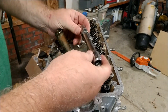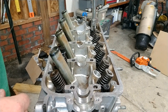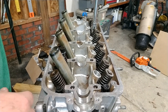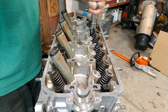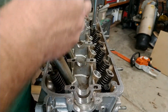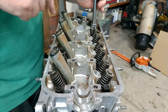I've started all of these by hand. Do not use any kind of tool to get those started — no ratchet or impact wrench. I've gotten all those started. If you have one that feels like it's a little bit tight, what I generally do is back it out a little bit, give it a little wiggle, and then go back down until I can get it threaded with just my hand. If you booger one of those up, you're going to be in for a world of hurt trying to get your threads for your head bolts fixed.